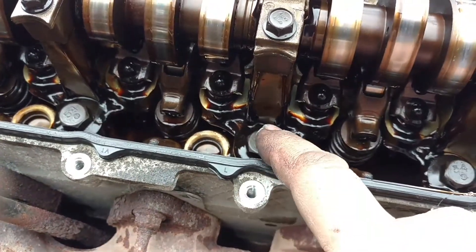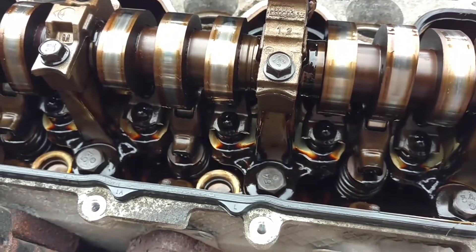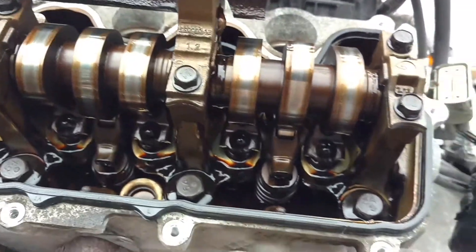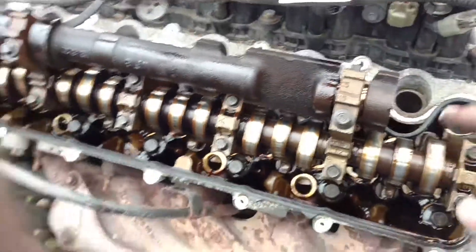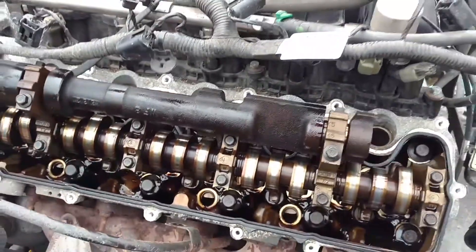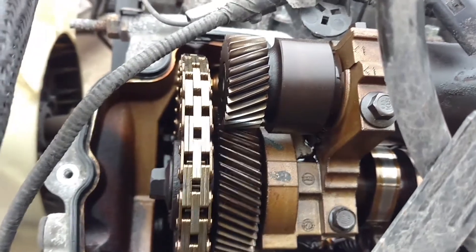You can see over and up in here, that's the oiling — it's making good oil pressure considering I'm on a cheap old battery with the cables not tightened up. And if you're wondering what this is, Ford calls this a balance shaft. It's only in the V10s — I've never seen it on a 5.4. It runs right off the front timing gear on the cam. I wonder if it has something to do with backlash of the timing gear. I'm not certain.